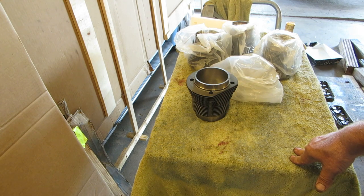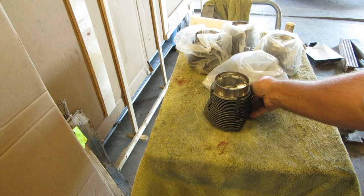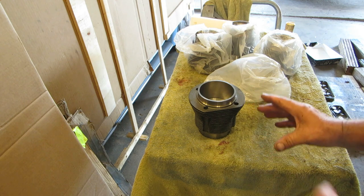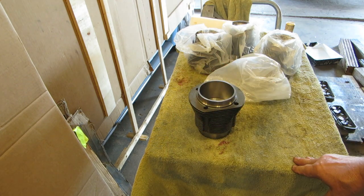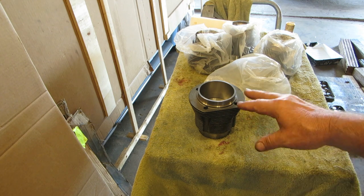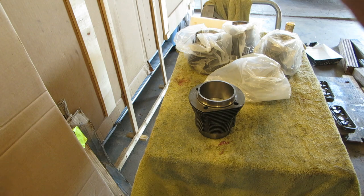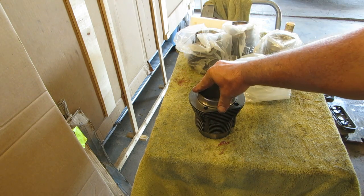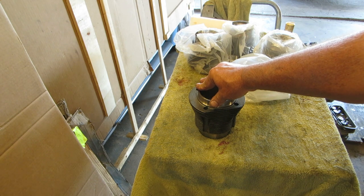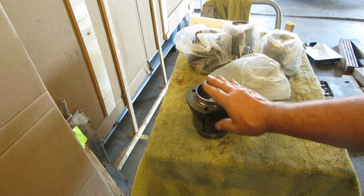Okay. Well, Dan, you just said that the bigger is worse. Right. But that's a completely different case, and it has to fit the hole here. So, of course, they just did the same thickness, but in 2 liter. So the whole cylinder was so much bigger. So, those eggheads at Volkswagen, I'm telling you, I'll get a lot of comments about, oh yeah, I built a 3-liter engine and went 400,000 miles. Yeah, okay. But understand something: what made Volkswagens so dependable and made people fall in love with them was their dependability and their reliability and all those little things that the Germans did, such as not go any bigger than 1598 or, you know, 85.5s, 1600 cc.